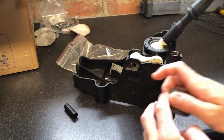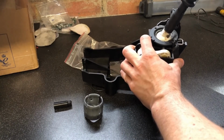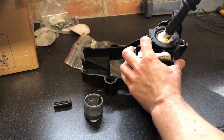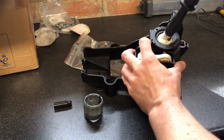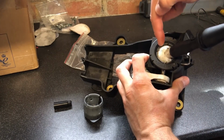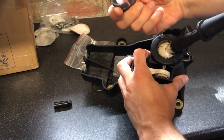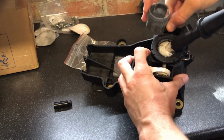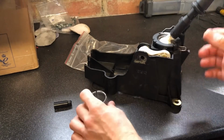So the movement I'm talking about is this. When you're in gear, you can see that movement there, that play. If you go out and look at your own gear stick and do exactly the same thing, you'll see it's worn. Now this ball joint in here is not the problem, it's the bush itself, which is this section here. So this is a brand new section, and in the next video I'm going to show you how to replace it all, and I'm going to take the gear stick selector apart.